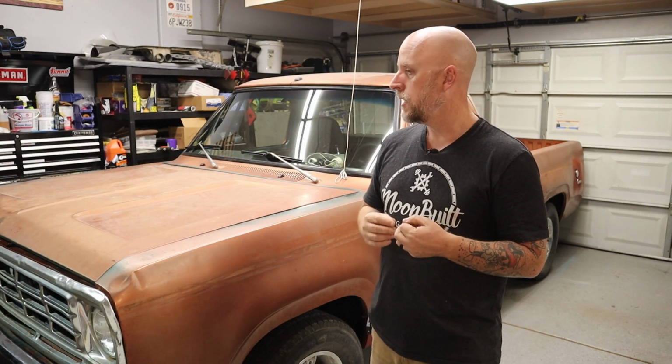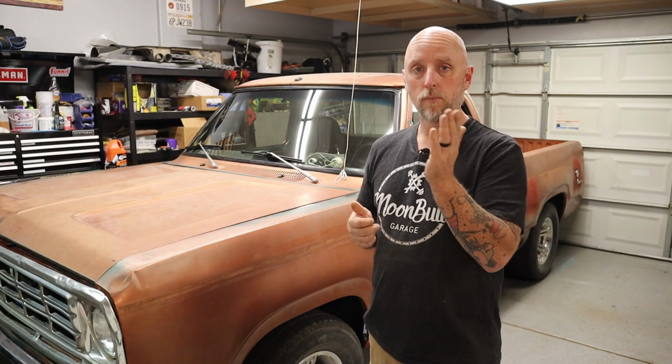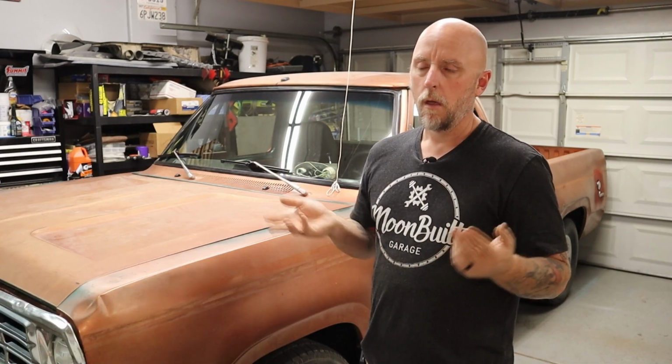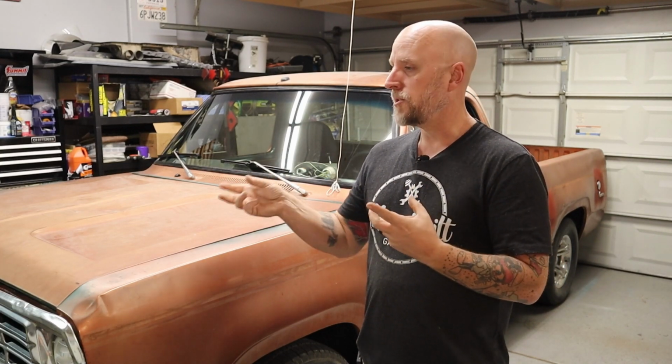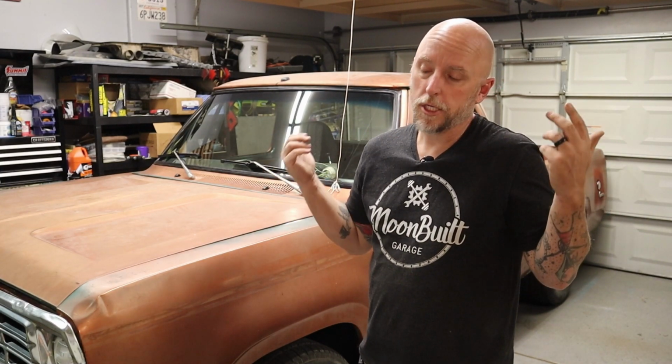So I got home, I started playing around with temp gauges. I have a couple of them on the bench over here. I swapped one out for another one, turned the truck on since it was still hot, and the temp gauge came up to more normal. In the process, I had also swapped out different voltage limiters. So apparently I've got a combination now that works. Whatever. I call it a win.